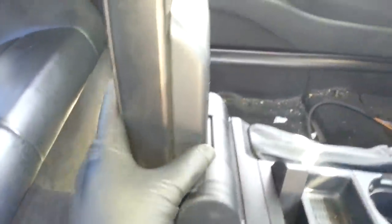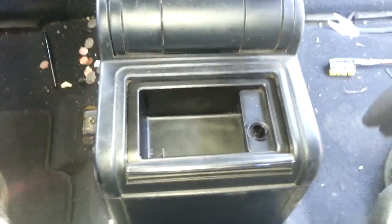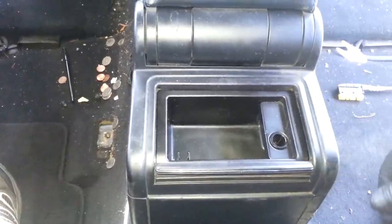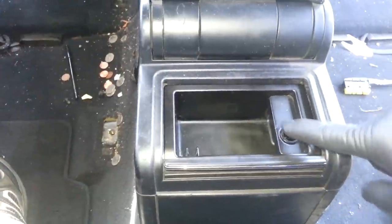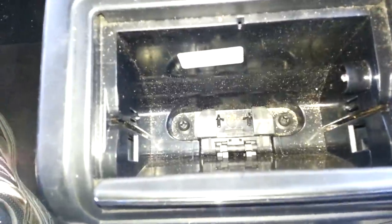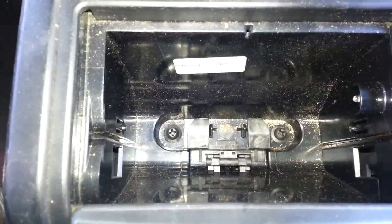First, bring this down here. We're going to start back here. I like starting back here because I can work myself from the back to the front, and along the way you're going to discover screws that will make the removal process much easier. So what I do first is I pull this off — all I have to do is pull it out. Pull it aside. If you look inside you're going to find two Phillips screws — let's go ahead and take those off.